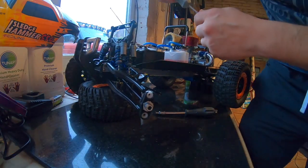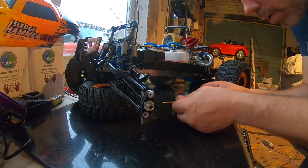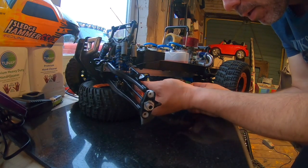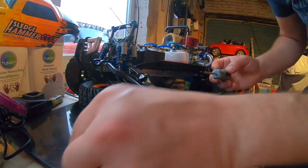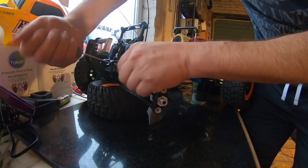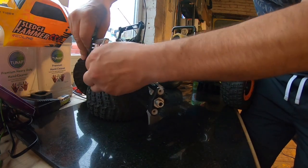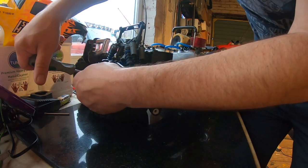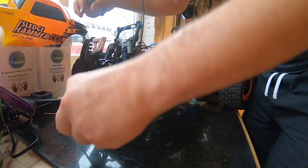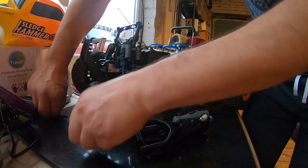Next I'm going to unscrew the shocks. Then I'm going to remove the pins that hold the upper and lower arms on — they should have a screw thread and just pull out. There's one; the other one's just behind the front bumper. Right, there we go — that's the whole assembly off. The pins for the upper and lower arms are different lengths; the upper is obviously a lot wider than the lower, so just have to remember which way they go in.